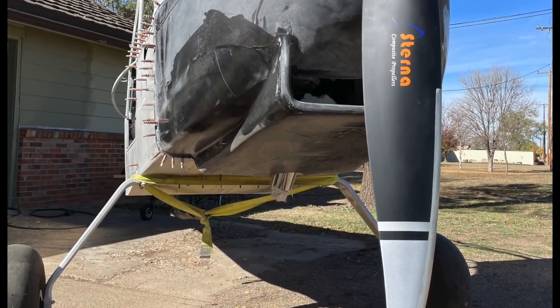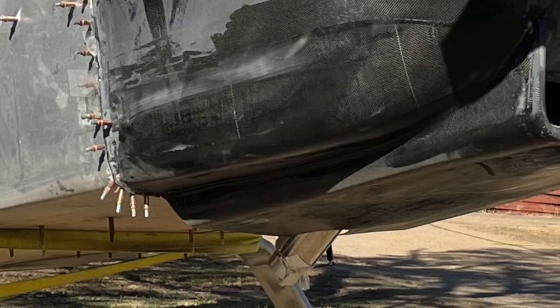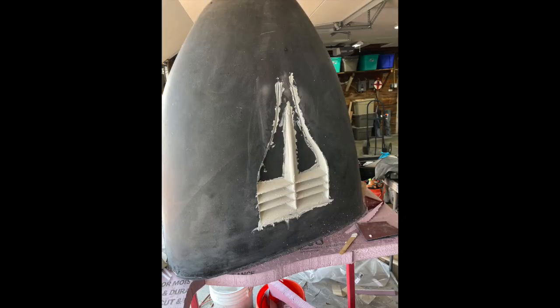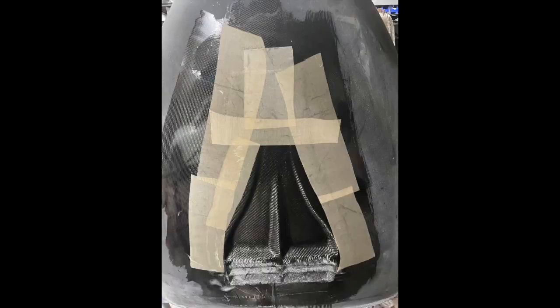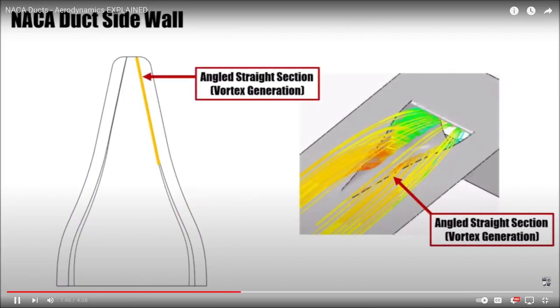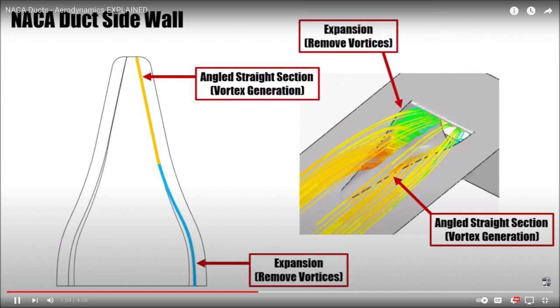With the pressure side figured out, let's look at the exit side. Like pretty much every airplane, I have an opening at the bottom around the exhaust that will cause a vacuum drawing air out from inside the cowl, and I sized this opening to be larger than the intake to help with that pressure differential across the cores. In addition, I have extra extraction in the form of a vent up on top of the cowl. I needed to allow heat to escape from the cowl after a flight when airflow is no longer causing that vacuum effect. I didn't want anything sticking up from the cowl since, being a tail dragger, visibility over the cowl on the ground is already limited, so I inset these vent louvers and used a NACA-style duct to influence laminar flow down over the inset fins.